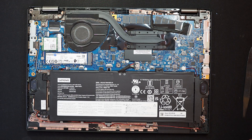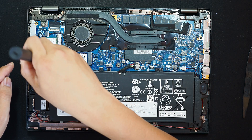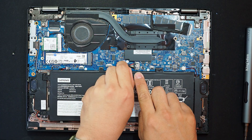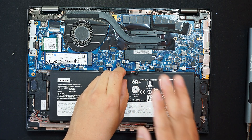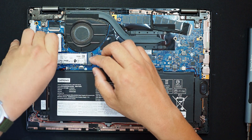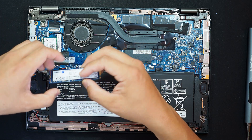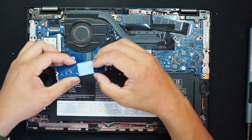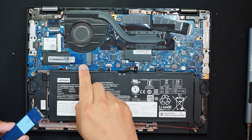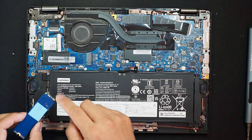My purpose was to replace this SSD, so just do one screw. Before you do anything, please remove this battery connector from the main board. Now I will replace this SSD. Looks like there is a thermal pad right here, so make sure you take it off and put it on the new SSD. There is a marking right there on the board — a square — so you know where to apply this thermal pad.